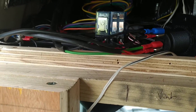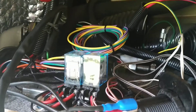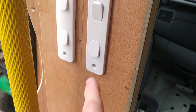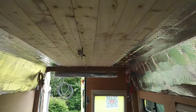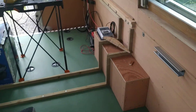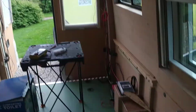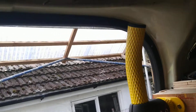The relay on the right — what I'm doing basically is when I switch the lights on with this switch here, it turns the relay on and connects these lights to my temporary auxiliary battery setup down there, giving plus or minus 12 volts on them. When the relay is off — when the lights are off — the relay connects these lights back to the original wiring.